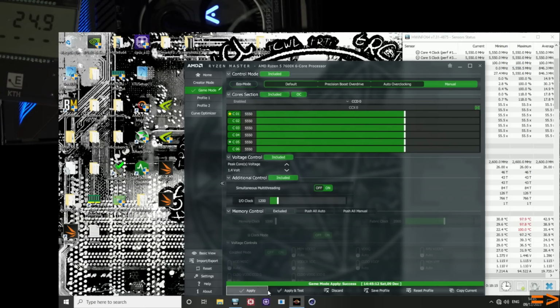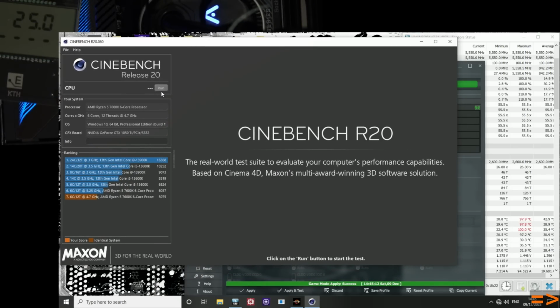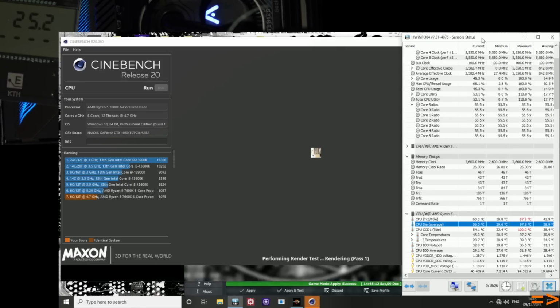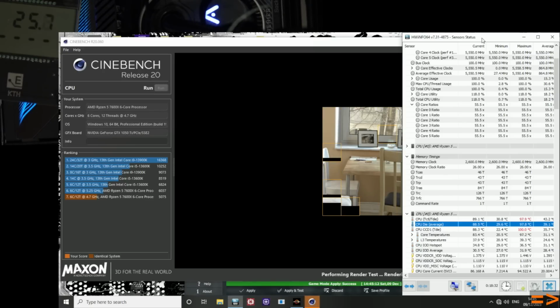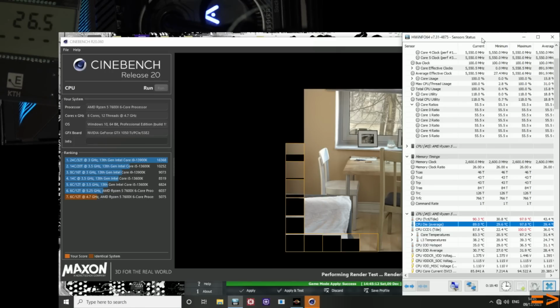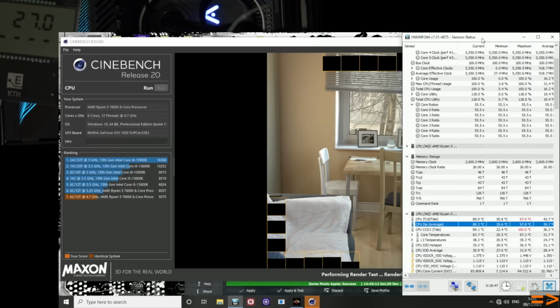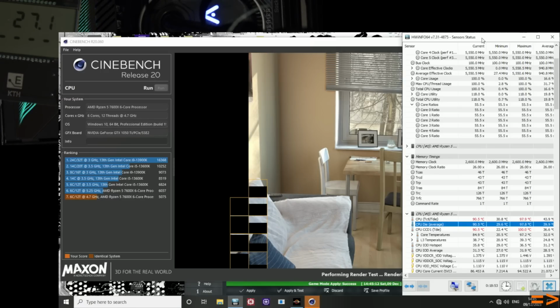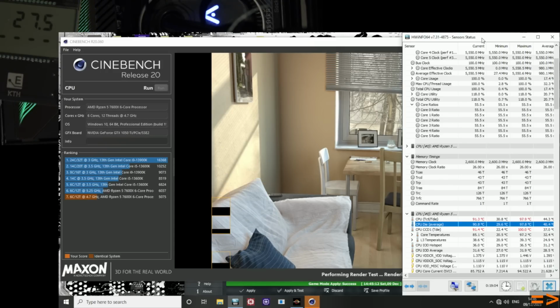This really isn't super complicated, but it is a very real problem with a lot of modern silicon, and it's the reason why a lot of modern silicon doesn't just scale to insanity voltages. If you look at something like FX CPUs or old Intel Sandy Bridge CPUs, those chips would scale to the point of dying, basically. Especially Sandy Bridge CPUs. FX CPUs were kind of indestructible in a way. They'd blow up your motherboard before the CPU itself was at risk. But the Sandy Bridge CPUs weren't. You could very easily see frequency scaling on a Sandy Bridge CPU all the way to 1.6 or even 1.7 volts on water cooling. And at that point, those chips start dying.